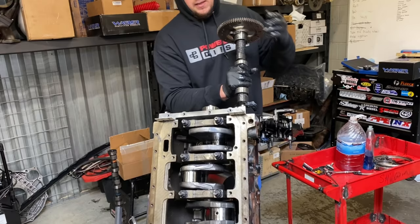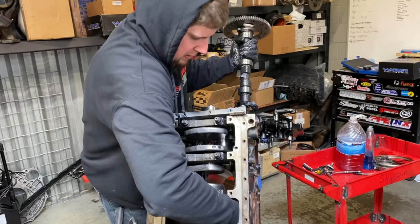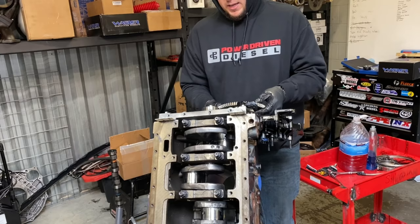Sometimes you've got to check the crank, make sure the crank's not having an issue, or a tappet. Is it hung up? Like so. So we're fighting a little bit of the tappet there. If it doesn't want to go smooth, I've seen that video floating around on Instagram of them beating an LS cam in. Would not recommend it.